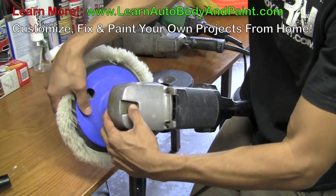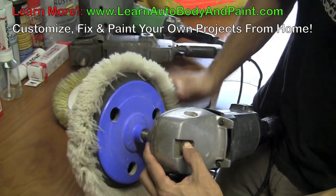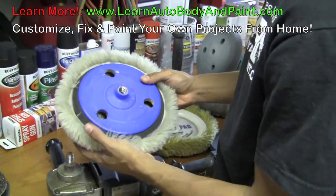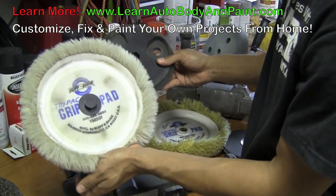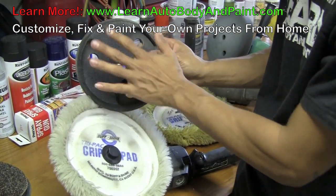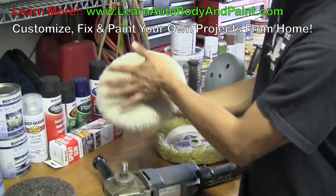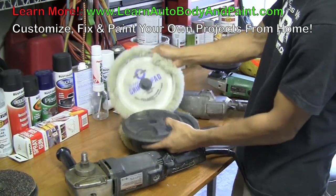This has a lock so you can turn your adapter off really quick. Just going to talk to you about adapters quickly. Most times they're universal — these are usually the same size on a lot of buffers. I do recommend going to buffandshine.com or your local auto body store. They probably have this type of adapter. You can get the Buff and Shine pads with this adapter — very easy to go on and off. As you see, it has the guide here that goes in the hole to make sure you're centered, so you don't have a wobbly, off-balance buffer. They go right in like this — you just slap them on. You could change from your foam pads to whatever pad you want.